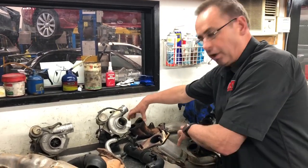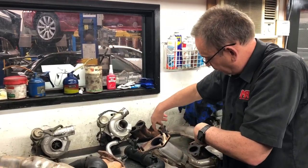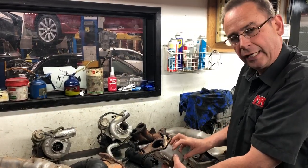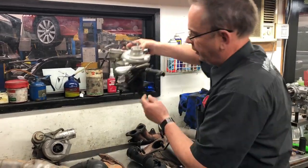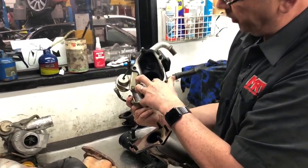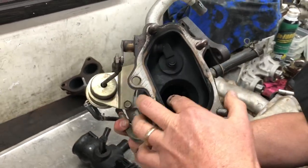Let's talk about a factory standard Subaru production road car single scroll setup. When they say single scroll, it's got one pipe that leads up to the underside of the turbo. The exhaust ports on either side of the engine go out through two collectors, join in the middle into one single collector across the front. The two sides collect together and go into the up pipe — early model cars have a small catalytic converter, most current models don't — and a single pipe leads into the underside of the turbo.